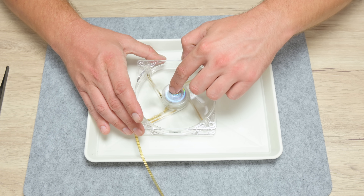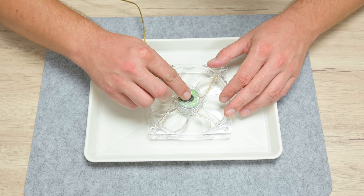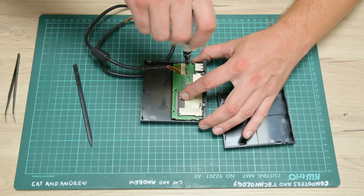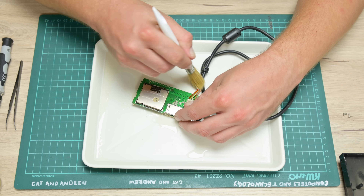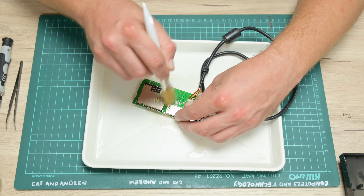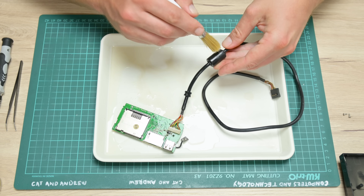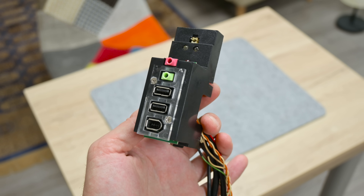Before this, the cooling fan was a little loud, but now everything is much better and the fan is spinning smoothly. The other cables and electronics I clean in a very similar way — plastics I wash using soap and water, and electronics I clean using isopropyl alcohol. This applies to the card reader and the front panel electronics with the power button and the USB and audio ports.